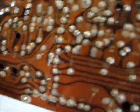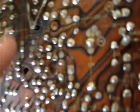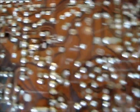Focus adjustments, red, green and blue adjustments — which you don't touch normally. Being repaired. Another copper one in here, it's all corroded and got really hot and burnt that away. Let's see why this TV didn't last too long — the heat broke it down real quick. It's the only drawback to these types: the heat breaks them down.